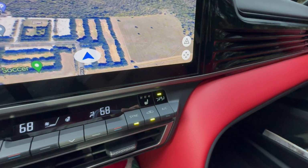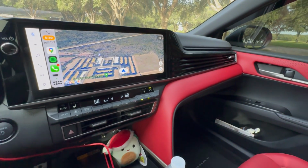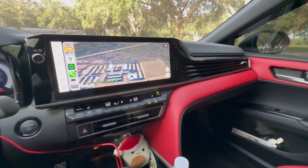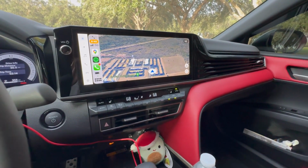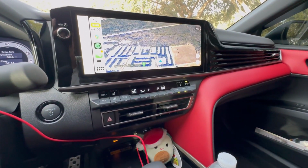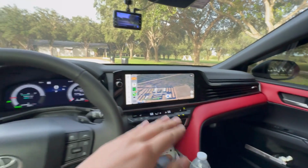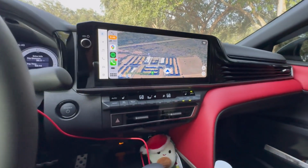Now, what S mode is, basically, when it is on, it'll only direct the air conditioning to the front seats and not to the back seats. So the theory behind that is, if there's nobody sitting back here, there's no need to use this, right? So to conserve a little bit extra gas, when this is on, the AC won't pass through here, and it will be just directed up to the front seat passengers.